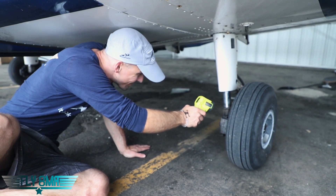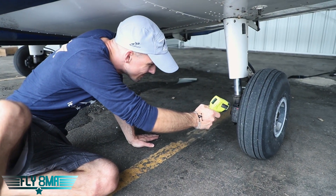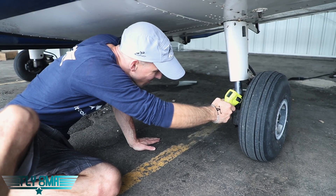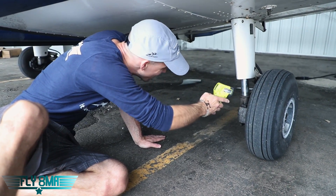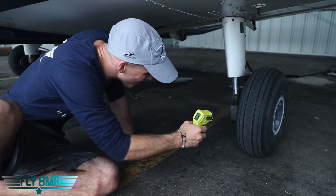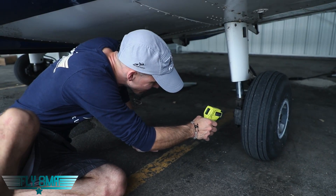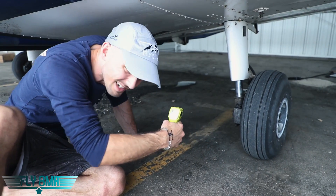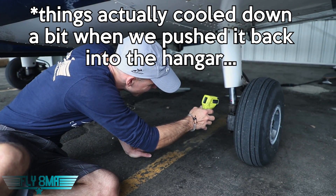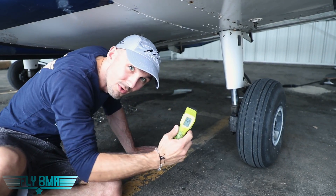Back in the hangar looking at about 345 to 360 degrees. It's hot — the inner part of that rotor there is reading 350, 346 degrees — pretty warm. The actual caliper itself hit about 200 degrees; it's probably still taking some time for the heat to dissipate throughout it, sitting at about 204 degrees for the caliper. As far as the rest of the assembly, we're starting to see the bottom of the strut hit about 100 to 102 degrees.